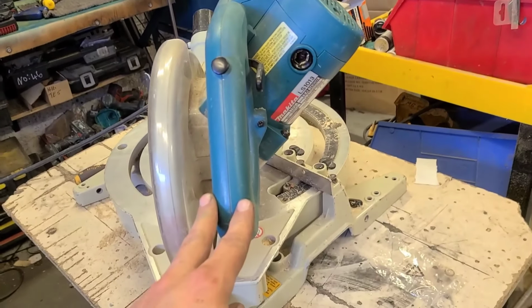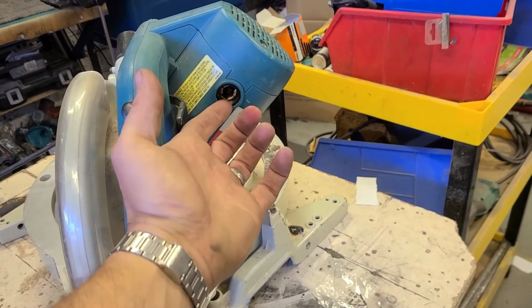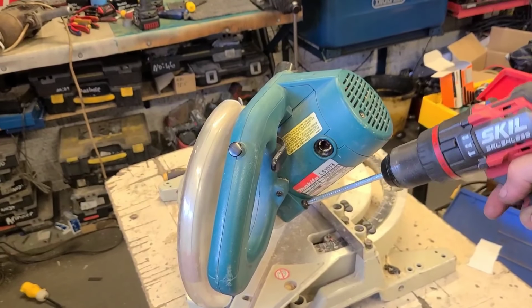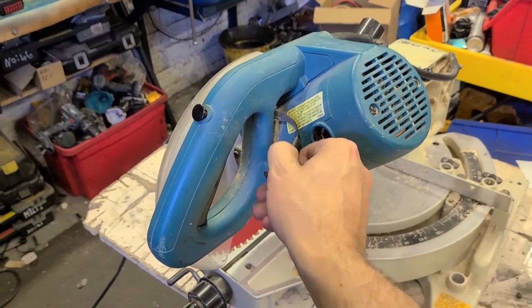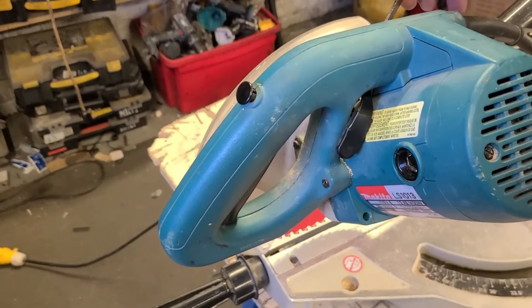Fix this. It's actually quite simple. Pull off the motor, take out the armature, put a screwdriver on the other side, and just knock them out. I could nearly guarantee that the armature in this should be fine. Also, pull off this wee arm, lock lever.